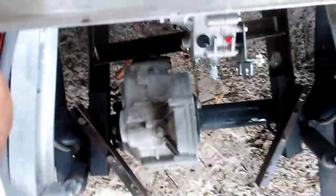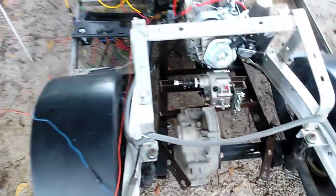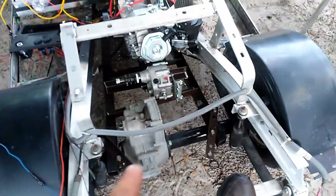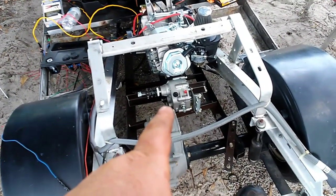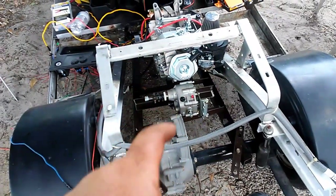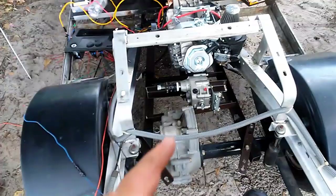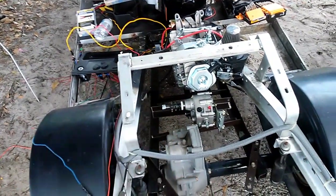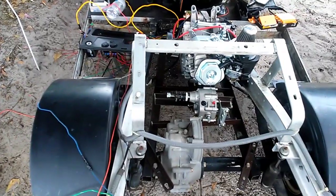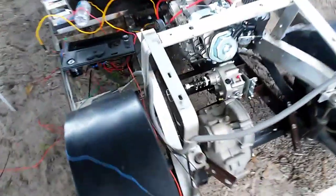When I bounce on the back, notice there's no gap difference right there, so I don't have to worry about tensioners. What I'm going to do is put the chain on the back to that sprocket, pull it tight, weld those plates in position, and that'll be the tensioner for the back. Then the motor slides so I can tension the chain from the front. That seems to be what I'm going to do at this point. Got all my wiring done.